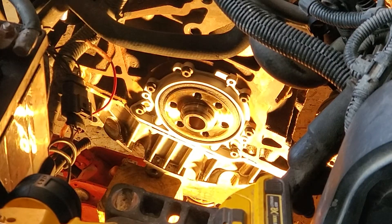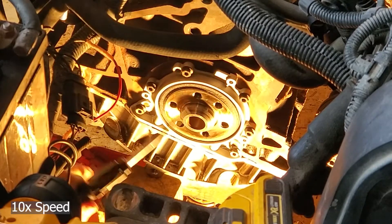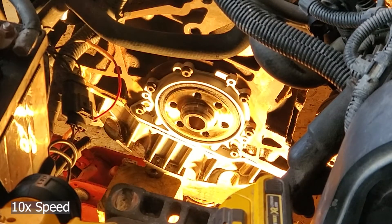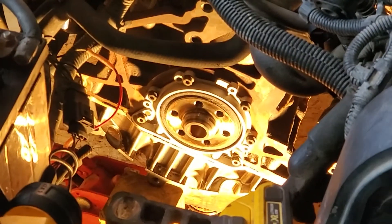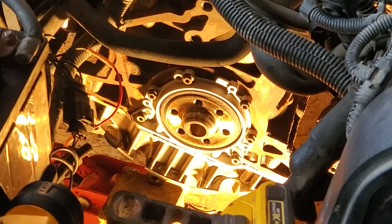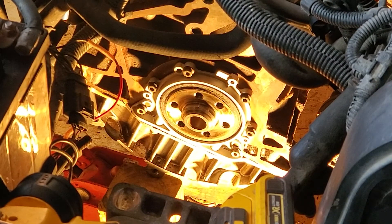There's a little bit of sealant there still. I'm going to clean up the spacer shield plate and then put that back on. It's got some oil around the outside, so I'll clean up the flywheel too, and then put that on as well with a little bit of Loctite on the bolts and go through the torquing procedure for that.